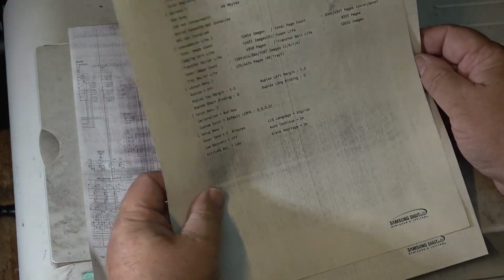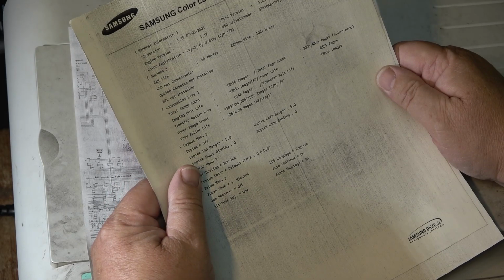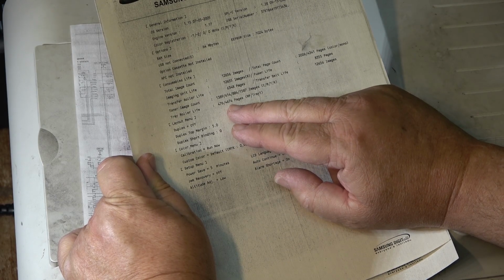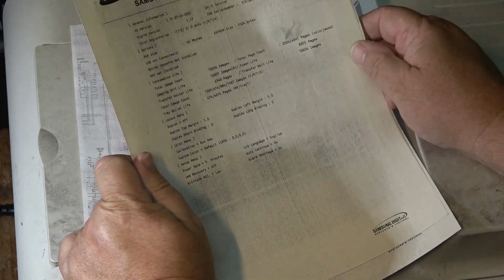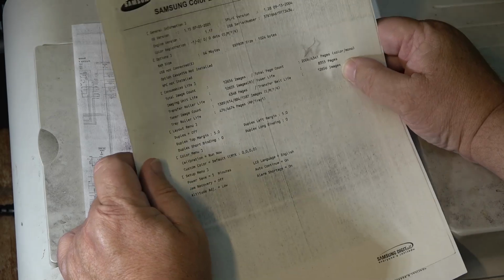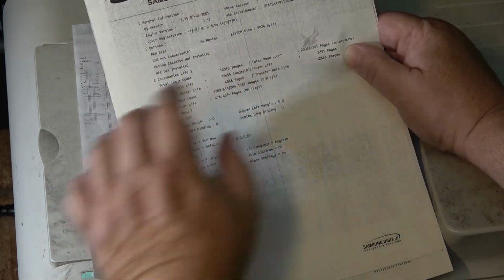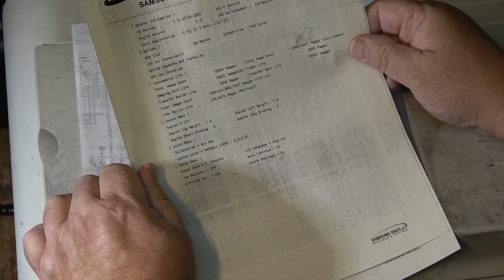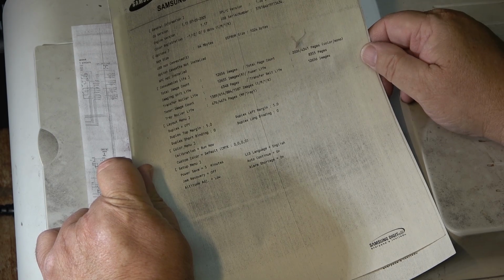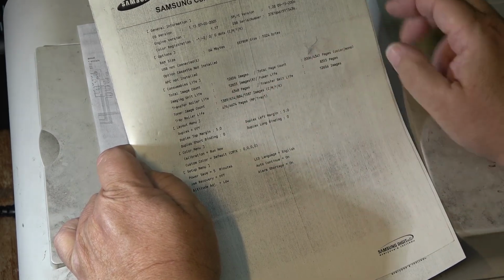I'm sure that drum has these are the page counts on the consumables that are in there now, but the imager has had where are we here? 12,656 images on the transfer belt. The fuser 8,500. That's the times that the imager has gone around the transfer belt. Page count on this is not all that much. 4,300 black and white and 2006 color images, but the total image count 12,656.